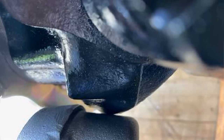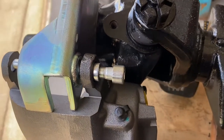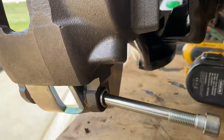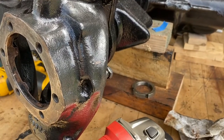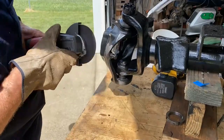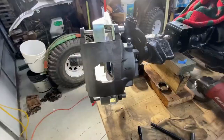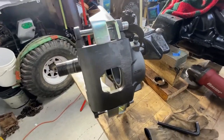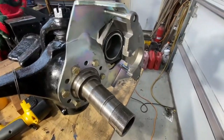The bracket goes this way. Without doing any clearancing you can see where that's going to hit — there's the top bolt ran through the caliper, and the bottom you can't even get started. Here's what it looks like before I do any clearancing at all.